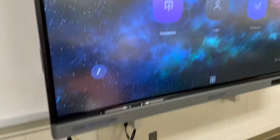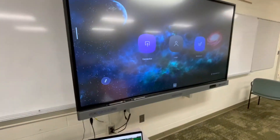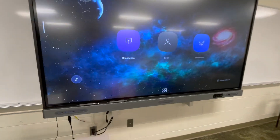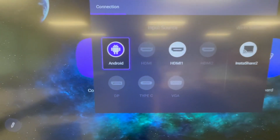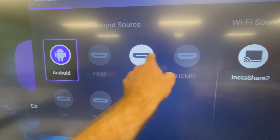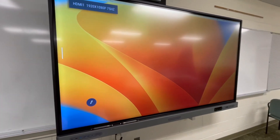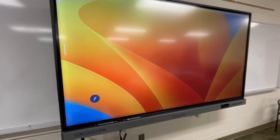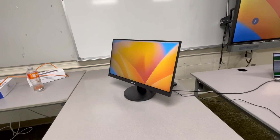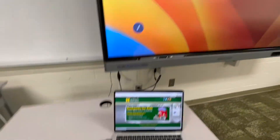Now my MacBook is connected. However, you'll notice that the BenQ does not display the same as the MacBook. We're going to talk about how to slide the MacBook screen over to the BenQ. First thing you have to do on the BenQ is set the connection — it's very, very easy. Simply come up to the BenQ, you can do this with your finger, and tap the connection button. You'll notice one of these HDMI options will be highlighted — click the highlighted HDMI option. Now you'll notice that my BenQ is an extended version of the Mac, not mirroring the Mac. I'm going to swing over and show you my external monitor on my desk. You'll notice that external monitor is the same screen as the BenQ. Next, let's talk about how to get this screen over to the BenQ.